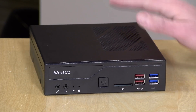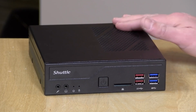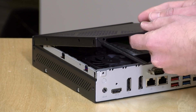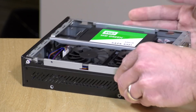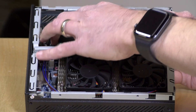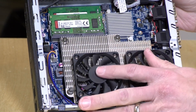Let's take a closer look at the hardware. This costs $379 as a bare bones kit, meaning you have to buy the CPU, RAM, and storage to make it a complete computer. It will support any of the Coffee Lake generation Intel CPUs — an i3, i5, or i7, and I also believe there's a Celeron option as well. It is very compact inside, and that will represent an issue for cooling and fan noise, which we'll talk about later. There's a huge heat sink here on the CPU.